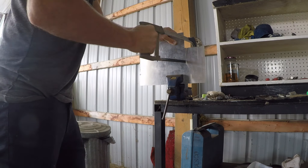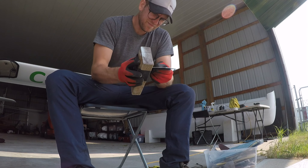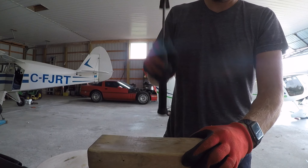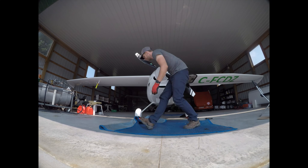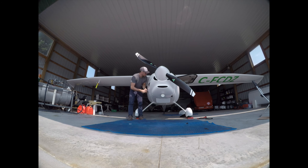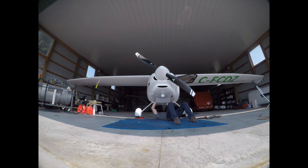I'm going to make an aluminum plate that will attach to the base, the body, inside of the cowling there. I got my template cut and marked out on the piece of metal. I'm going to do exactly this shape and do a little bit of extra overlap so I can bend it 90 degrees, and I can secure it then to a post there inside.